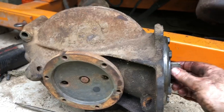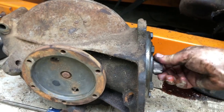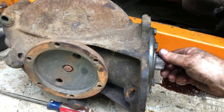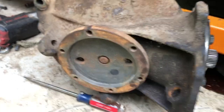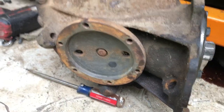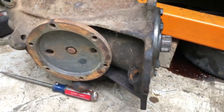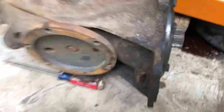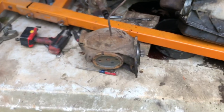Here's a notch here. One, two, three, and then 07. So that is the factory final drive, which means we'll be taking this and cleaning it. I will now order my ring and pinion to change this into a 370, which is going to just be really the final icing on the cake for drivability. The motor is running great with the new intake on it.